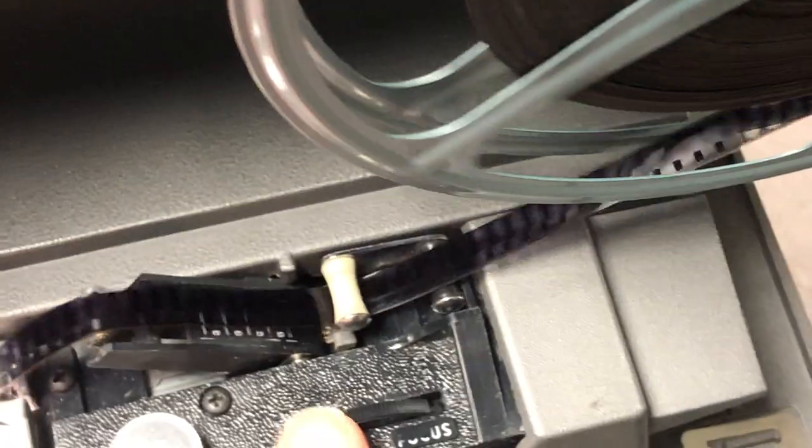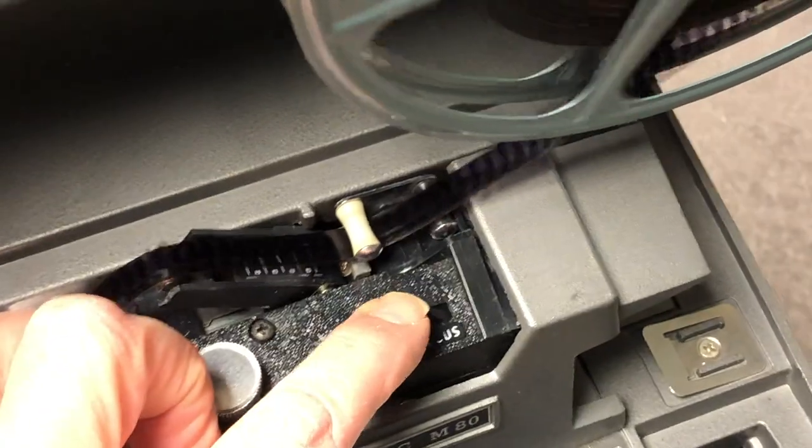There is what's being projected. You can see it's not super in focus, so I'll adjust the focus. I'm going to turn this focus button this way or that way, and as I do you can see it starts to kind of focus better. There's a dark line down the middle of it. If you see that, you want to press and turn the frame button, and as I turn the frame button, that dark line should go away.